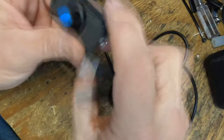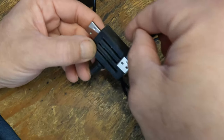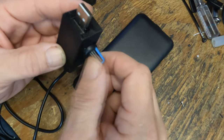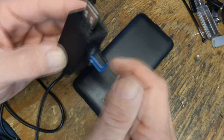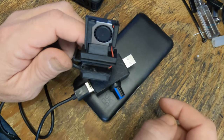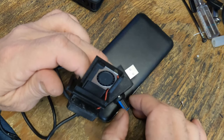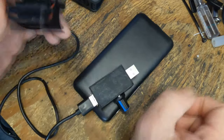What we have here is a speed controller. This is the one I'm going to use with it for now, but they make another one where the USB plugs go here and here — I like that because it's less likely to get bent. I believe it's boosting the volts — you go all the way down to 3.2 but I believe it's bringing the 5 volts all the way up to about 7-point-something. If you go past 5 volts this thing will make a lot of racket and you start getting a lot of turbulence — negative pressure on your blades. It'll actually cool better spinning slower because it's not a mess of airflow at the optimal 5-volt setting.